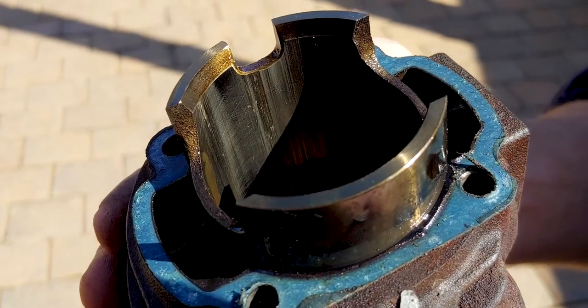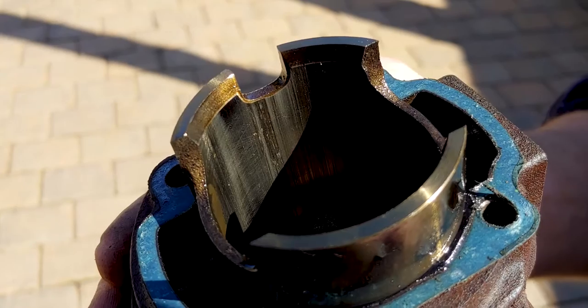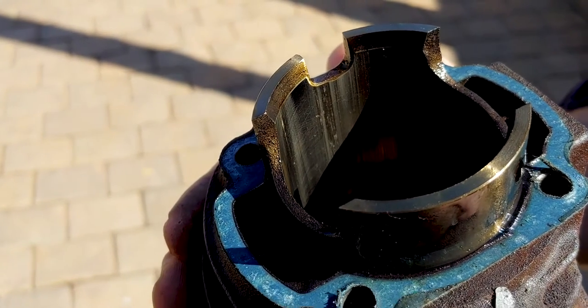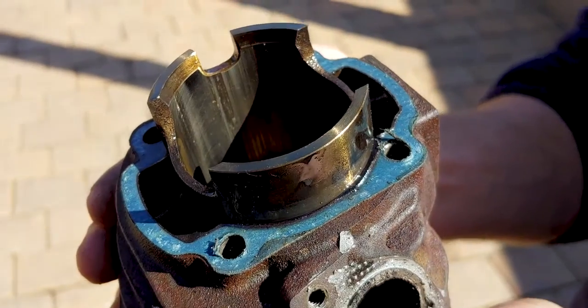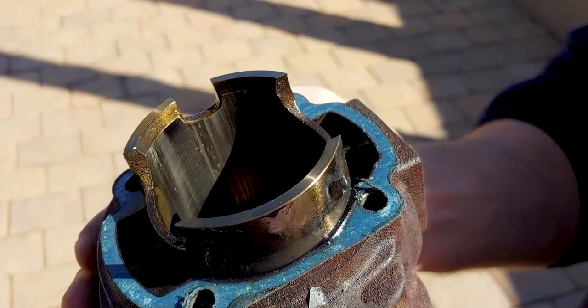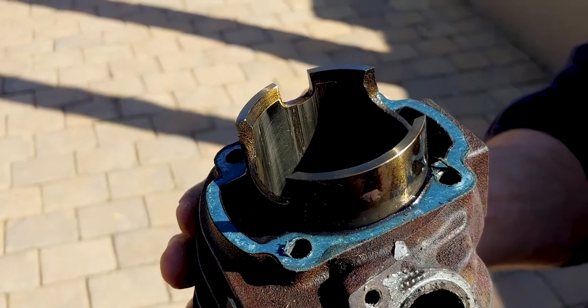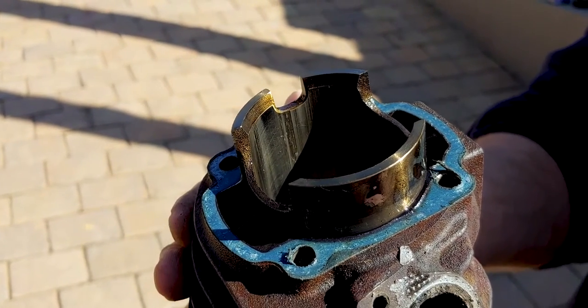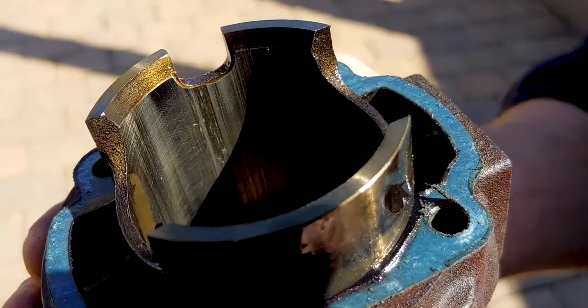There's the barrel — it's off and massively scored. This barrel is due for the dustbin, or in this case due for overboring. There was a Porsche going past — a little air-cooled jobby, bit of a two-stroke connection in a way. We'll re-bore that at some point, but in the meantime we're fitting another piston kit and checking the current piston for damage and scoring.